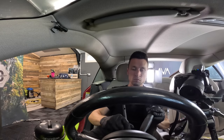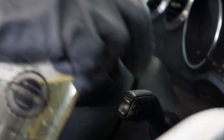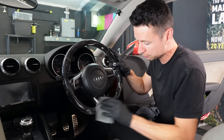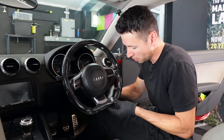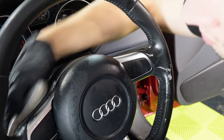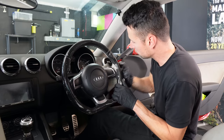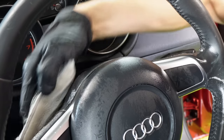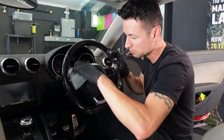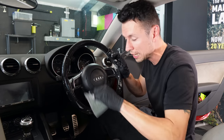With the dusting ticked off, we can now grab a scrub pad. Before we start using it, it's important to prime it first which will soften it up. All I'm doing here is running it over the steering wheel ever so lightly — I wouldn't really say we're scrubbing it as such. We just want to go over it at least once and see how it comes up, because with leather, if you start scrubbing very hard to begin with you could take off something you really shouldn't. Some of these old leather steering wheels have just deteriorated over time — the last thing you want is to scrub heavily, take it off, and then have to get it re-dyed and re-protected, which is going to cost more money and time.